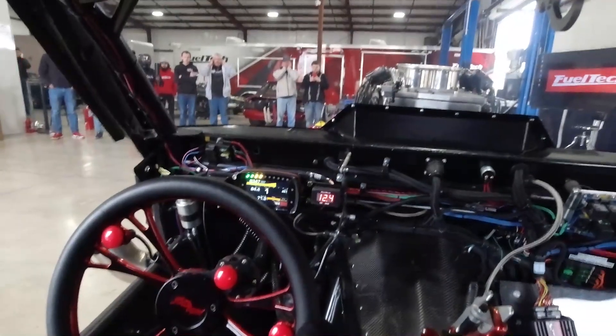If you have a big tire car and you have a nitrous motor, you can't leave on a single kit — it's going to shake the tires. But if you start on six kits, it may hurt the motor. On the hub dyno, you can leave naturally aspirated, then do a single kit run, then two kits, three kits, four kits, five kits, six kits. You can do whatever you want — there's no tire shake. If you want to test your lockup, you want to see how much the lockup improves the car, you can do it. Do a run without it, turn it on. You want to turn it on earlier or later, you want to see where it spikes, am I shifting too high — you can go up and down the RPM during the shifting.